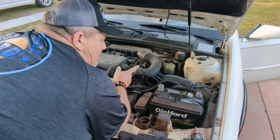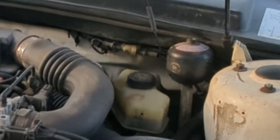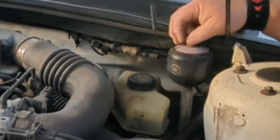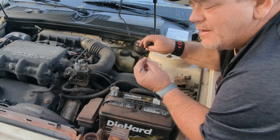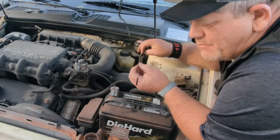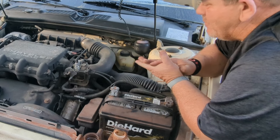It's got a braking system that looks like the old Grand National Power Master system, with this part being an accumulator. It's got an electric motor — that's a Power Master setup basically. Here's the transmission fluid — it's a deep burgundy color and smells like it's pretty burned up. Probably ought to try out some of the other accessories too.